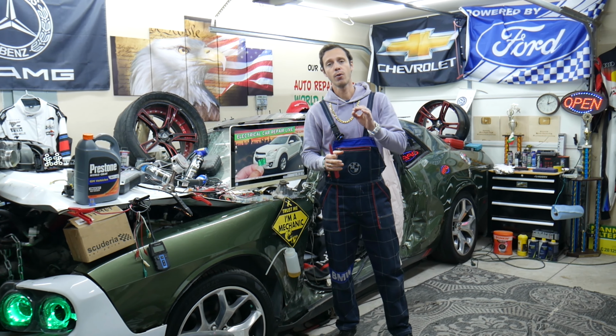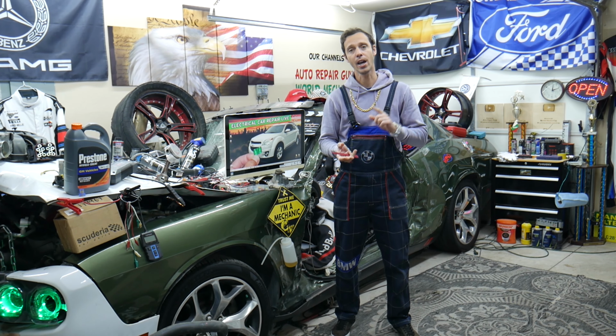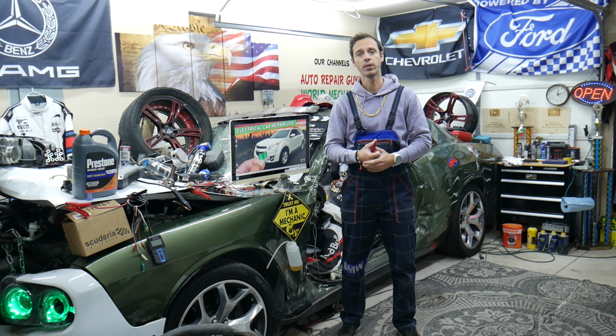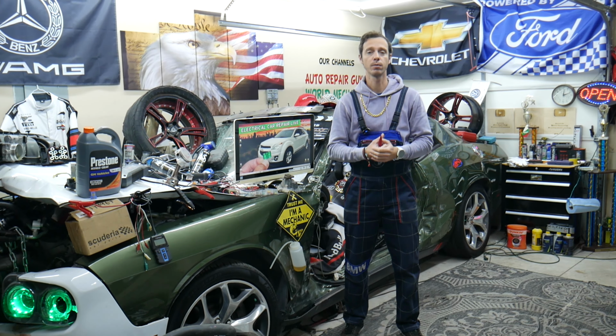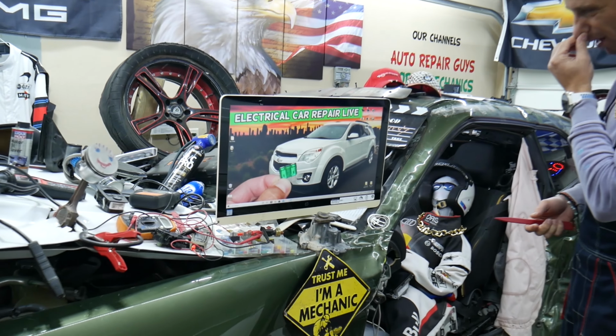First thing you want to check if your Chevy Equinox is overheating is some fuses and relays that can control the radiator fan control module and engine computers as well, because all those systems communicate together. Then we will explain, of course, mechanically what else can cause that, but always start with the fuses and relays, because it could be quite a simple fix. Come on guys, we'll show you what we have here now.